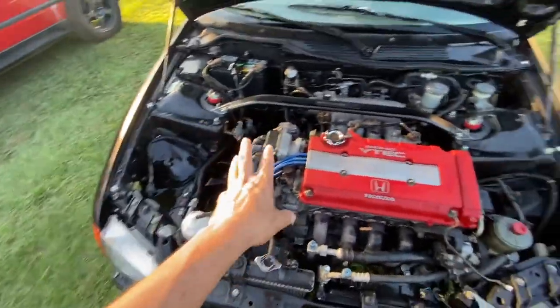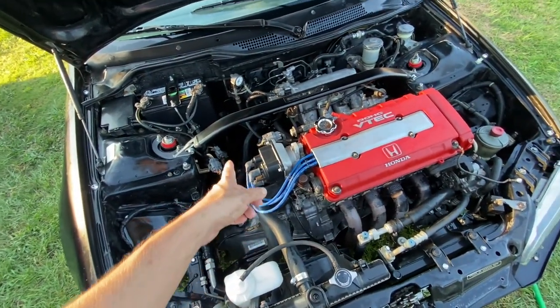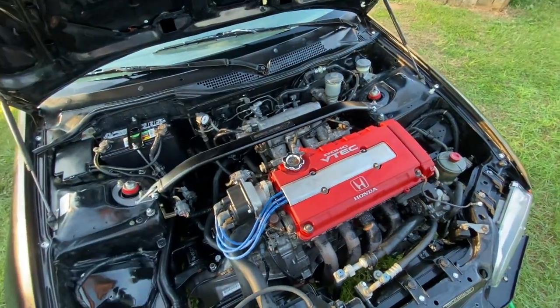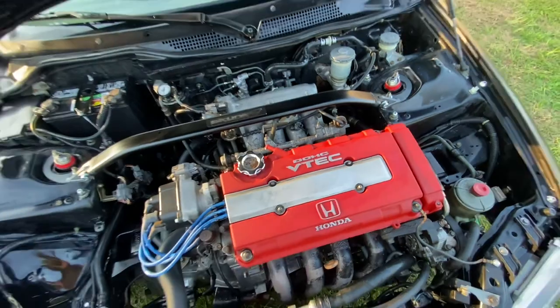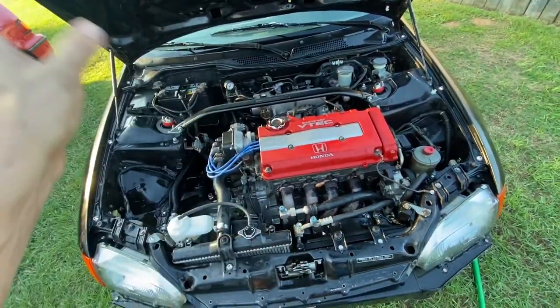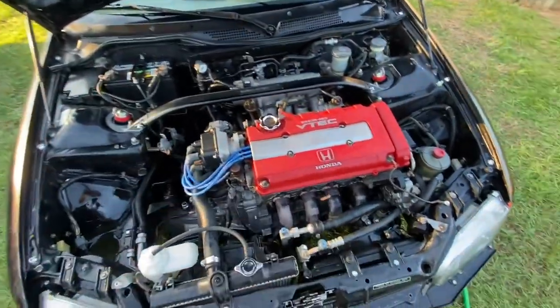Took all my bags off. Like I said, don't spray directly into the distributor because you don't want to get that wet inside. You don't want anything going into your throttle body and getting into the motor, and you don't want anything going inside the valve cover. Got all that blocked off, got it all done, sprayed off. Now let's get into the identification.